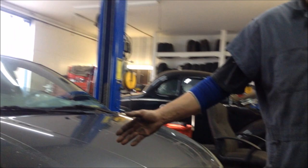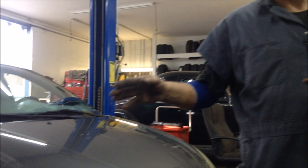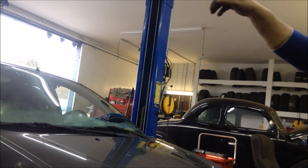So I just want to make sure we have that understanding about what could possibly happen after it's replaced. You're kind of leaning toward the slave cylinder being a problem — a lot of times the units are replaced together — but being that the leak is inside the car, the master is more likely. Anyway, I'm going to roll this car out right now across the street into that grass.